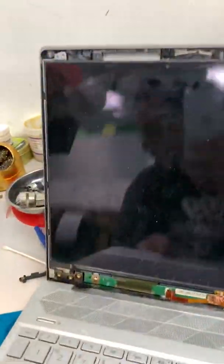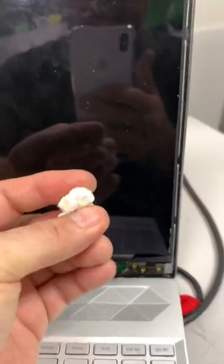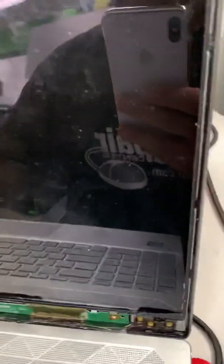It turns out that they used — I still have the piece, I got one side loose — what I did was I used a heater at 250 degrees Celsius, but you could probably use a hot air dryer or something like that. I heated up in this area back here and then got just enough to pry it open. I used one of these, just got a little bit of room, and look what I saw — it's like what you see on the back of an iPhone battery but on steroids, it's really strong. Once I got it loose enough to flex it out a little bit, I was able to see that, and then I did just like you would see in an iPhone battery replacement — I grabbed it and started twisting.